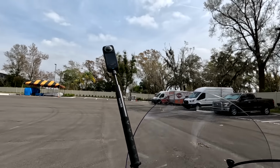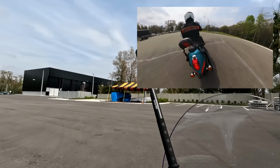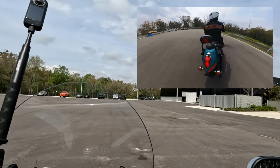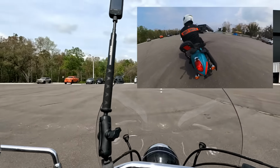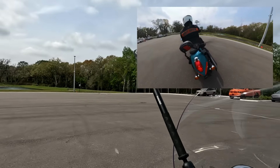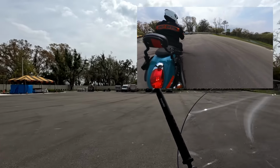Now once you get that, get used to using that friction zone. If I want a little more speed, I let it out ever so slightly. I don't have to increase the throttle. I don't know what RPMs I'm at. There's no tach here, but I'm guessing somewhere around 1,000 RPMs. Just start turning. Turn big circles, both to the left and to the right.